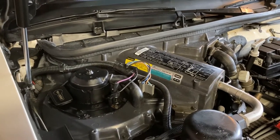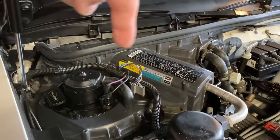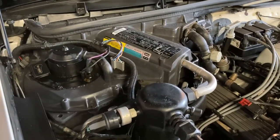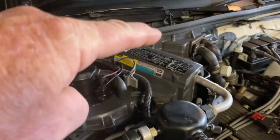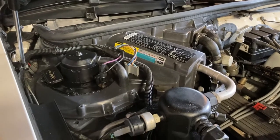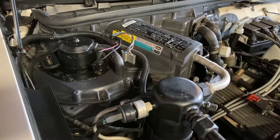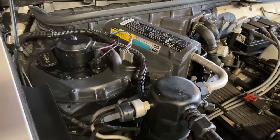The automatic feature had a thermistor to sample compartment air, and it poised the heat doors and so on. Instead of being on a cable, it looked at that thermistor and did it electronically. Again, pretty neat for the time. So we're going to go in here. I have found a Delco core, and we want a core that's tall and snaps in. The depth and the height, we want the correct core so we have that void filled properly. So don't throw a fly-by-night core in here that doesn't fit, that's a little too small or a little too large. Get the right one for the right result.